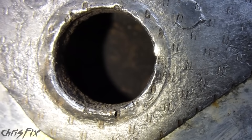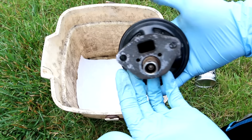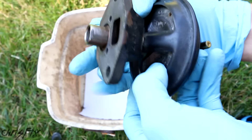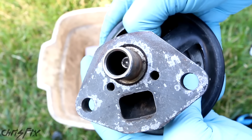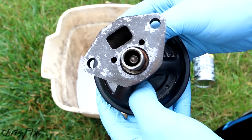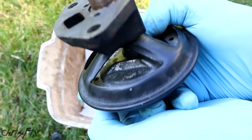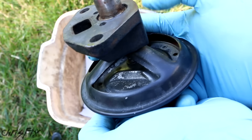In this case, it looks like there is no significant carbon buildup, which makes me think our valve might be bad. Before we clean the EGR valve, let's make sure it's working. This test works for any vacuum-operated valve. Right here is a diaphragm with a vacuum hose — the vacuum sucks in the diaphragm, which pulls the valve open and allows exhaust gases to circulate. I can move the valve by hand, which is a good first step to make sure it isn't seized. To test if the EGR valve holds vacuum: press down on the diaphragm, cover the vacuum port with your finger, then let go. The diaphragm should stay down — but you can see it keeps popping back up, so this one is bad.